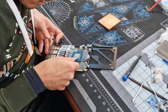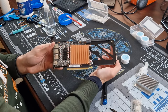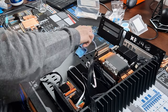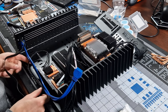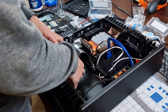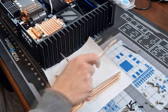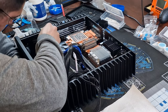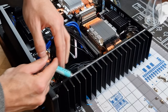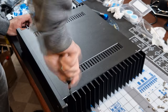For the GPU core I used regular thermal paste, while K5 Pro was applied to the GDDR6 modules — this approach proved successful. Next I covered all heat-generating components with heatsinks and prepared the case for the final modification: installing the GPU. I made sure to use the front panel as well for heat dissipation, as every little bit helps. I used a PCIe 4.0 riser cable, 20 centimeters in length. I cleaned all the heat pipes using alcohol wipes, applied thermal paste to the channels of the case and the GPU block, then installed them and sealed the heatsink. I also utilized the top panel for increased surface area.